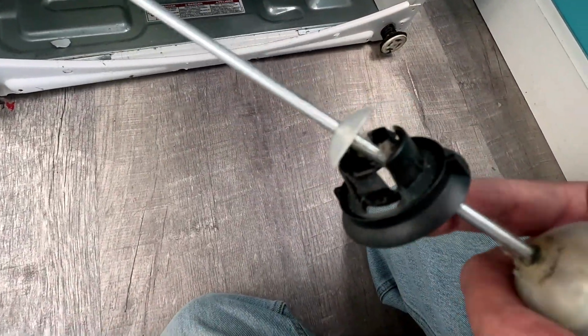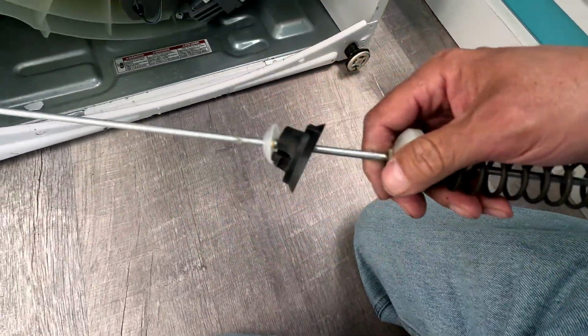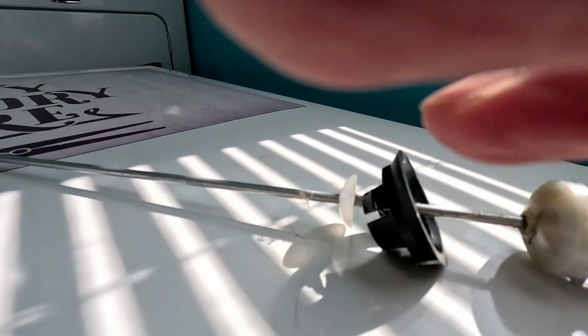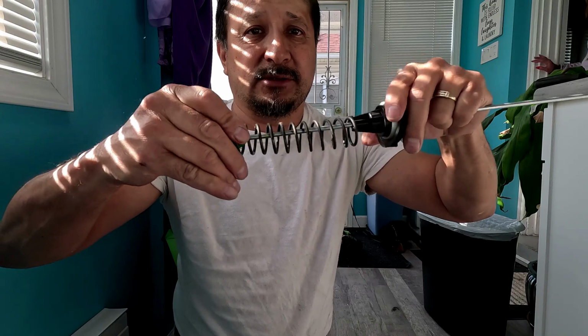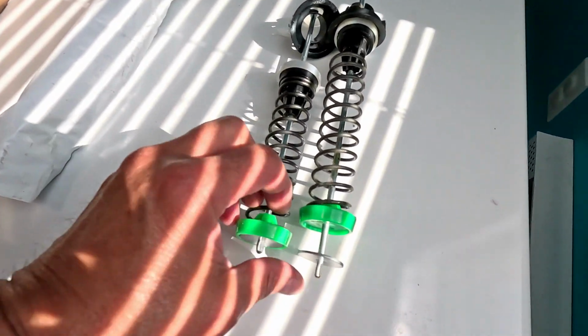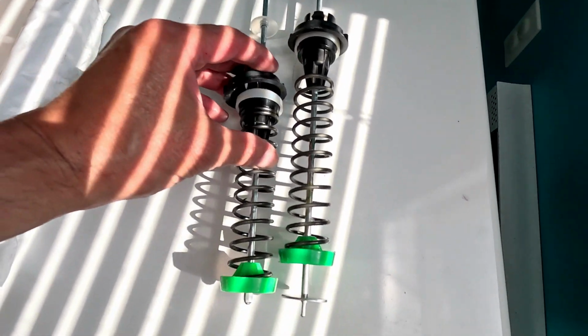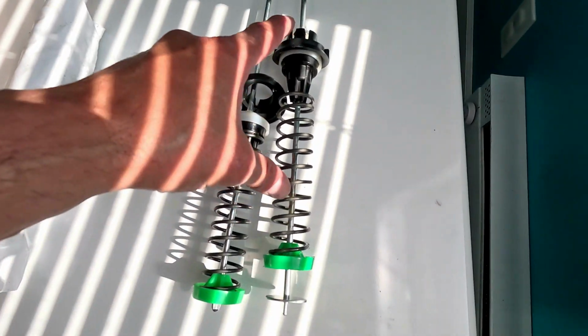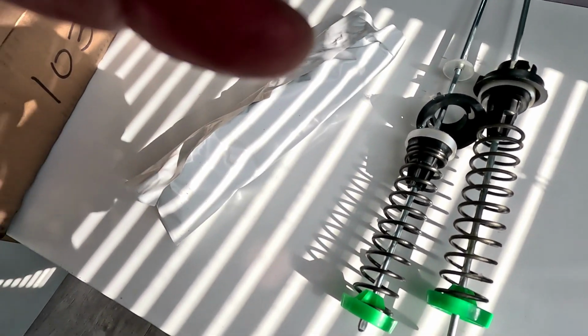So what fails is the bushings in here don't stop it from going back up. So they just bounce around aimlessly. See? They bounce around aimlessly. This top part doesn't hold down. So instead of it just dampering it, it's just throwing it. Alright, so you see this is off the bottom. This is already sliding up on the new one. See the difference? So this isn't holding it compressed. This is just letting it bounce around, and it gave us some extra pieces in here.